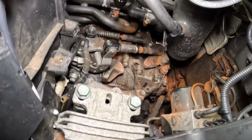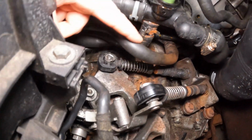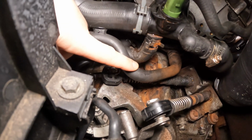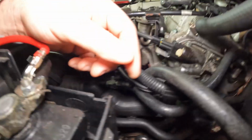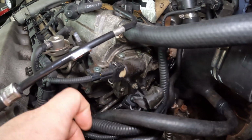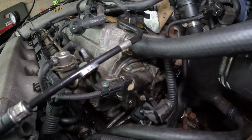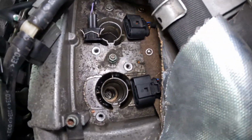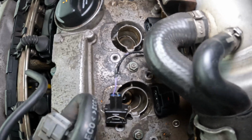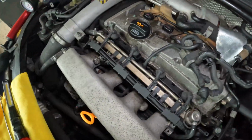And underneath here it does look a little bit grotty. A few of the pipes look a bit rough. I'm probably going to replace most of them, especially that bottom one, you can definitely see on top there, it's a bit rough. All the rubber's worn away where it's perished over time with oil dripping on it from the VVT solenoid and where the gasket's leaking. Now this gasket's getting replaced, the rocker gasket, because if you remember rightly, the holes here were absolutely chocker of oil. Now obviously we've cleaned it and I've not run it since, so there's no oil left down there luckily, so we'll get them swapped out.